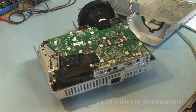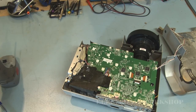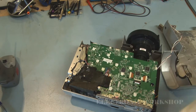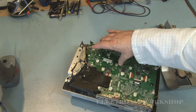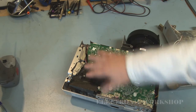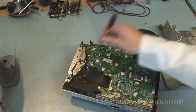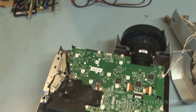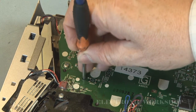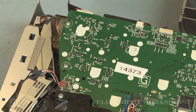I'm just going to reposition the camera to give you a closer view of where you find the fuse. Underneath this main board here is the main power supply where your AC comes in and sends voltages off to the various parts of the system. There's also a ballast board for the high voltage for the lamp below the power supply. There's a little hole here in the PCB — you go in there with a screwdriver, press down, and you'll feel a little click. That resets the thermal fuse.